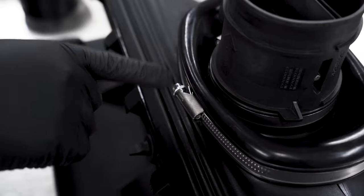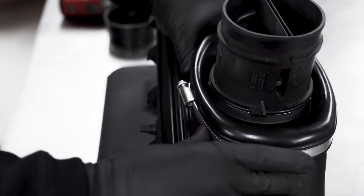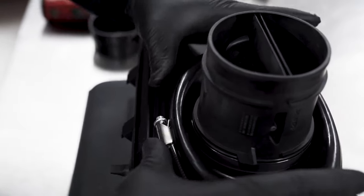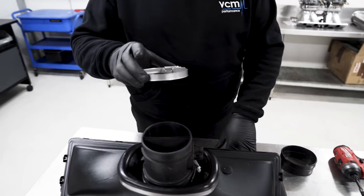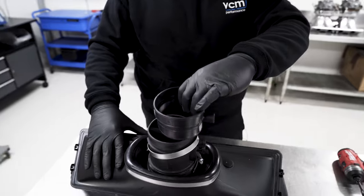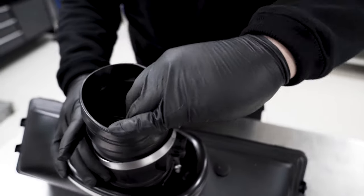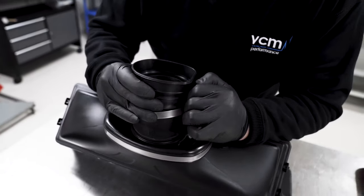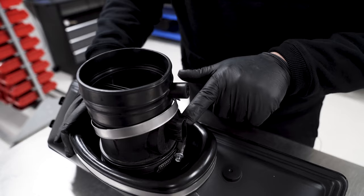Run the adjuster screw of the hose clamp underneath, and make sure you don't over-tighten the plastic OTR because you will start to crush the opening and it will give you an air leak underneath the OTR itself. Fit the hose clamp before fitting the MAF to throttle body reducer, with the PCV hose inlet coming on the same side as the MAF connector — clock that to sit just under the same position as the MAF wiring connector.